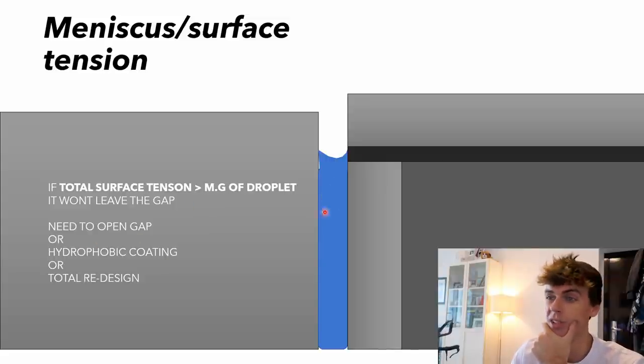But actually, the whole thing needs a total redesign, because this gap is a problem. I really do think this gap is a problem. Now, I've just looked at my Shimano cranks. I've got two sets of Shimano cranks, 6800 and R8000. They've both got stuff in this gap, kind of matter, that I can't clean out. I don't know if that's moisture or that corrosion's already started, but it's not good having that tiny gap, because it's hard to clean and the water can get in there and corrosion can start.